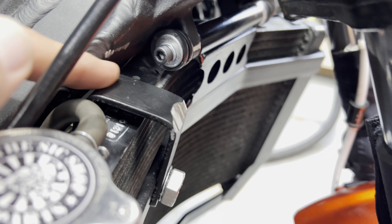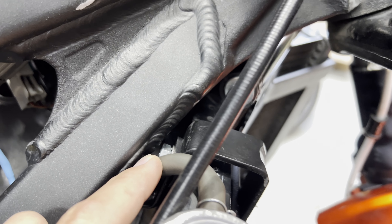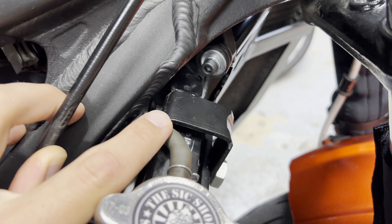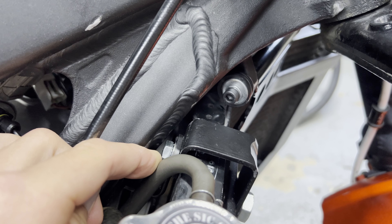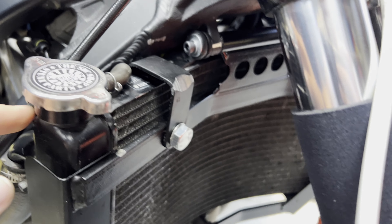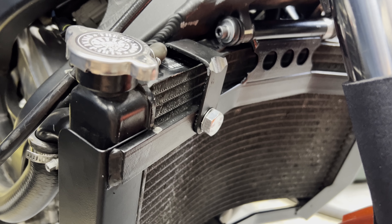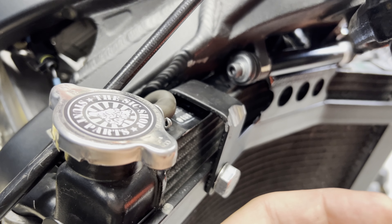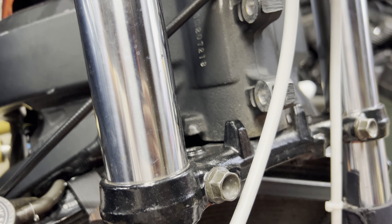This piece here normally would go towards the inside of the cage, but I re-tapped the holes and changed the orientation to give me clearance so it can stay straight up and down instead of being angled. The hose had some issues in the old configuration where I had to rotate it to get it on - now there's just a regular bolt instead of an allen bolt, so it's a lot easier to get a wrench in that tight space. I also had to go with an M12 bolt because I messed up the drill size for the tap - I was going to do an M10 but misread the chart and drilled too big. It's a huge bolt for there but it works.